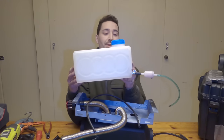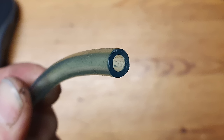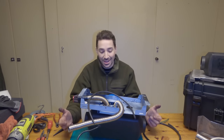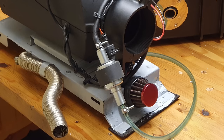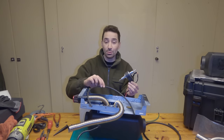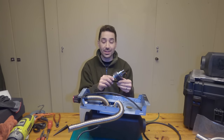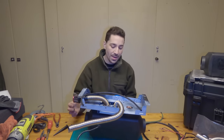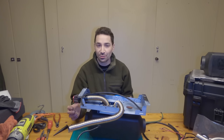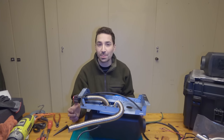The tank that came with the unit is about 5 litres. The fuel line that comes with it has about a 3mm internal diameter. But if you look on the Eberspächer website and recommendations online, they say the maximum internal diameter of the fuel pipe should be 1.5mm to 2mm. These little pumps work really hard if the fuel line is too wide — the cavitation bubbles from the pump can't move through the line, which affects the atomisation of the fuel at the glow plug and makes the pump more prone to breaking down long-term.